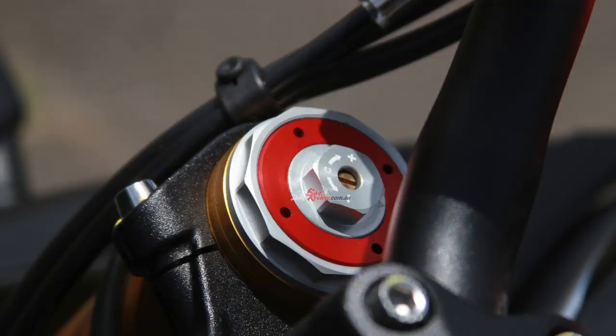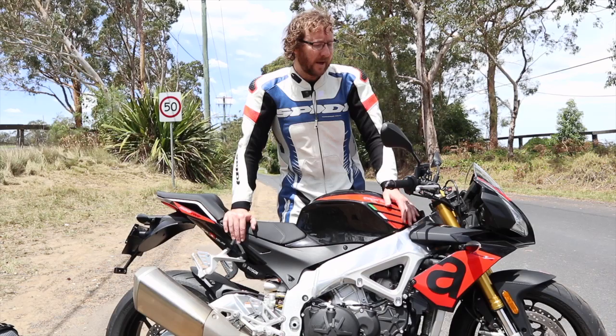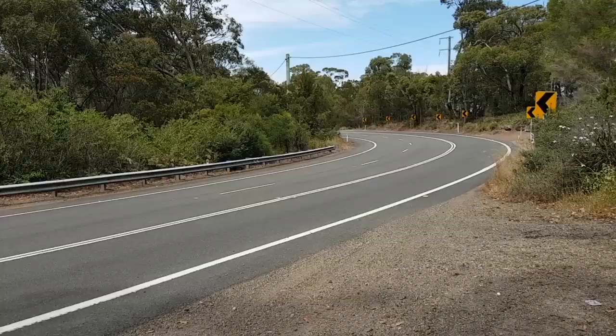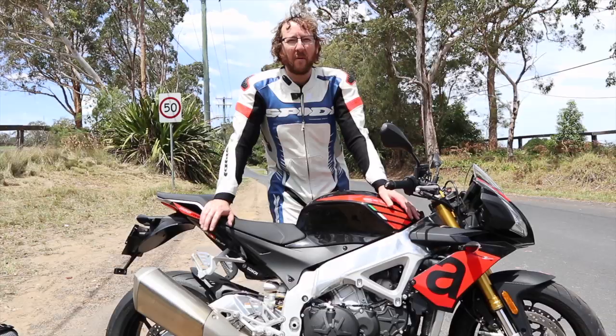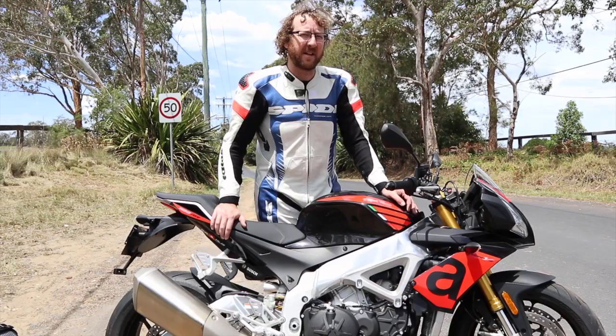It's got the SAC suspension and it's been fantastic, though I've got a bit of work to do on the shock setup. It's lacking in rebound damping at the moment and bucking around a bit, but I've still got the bike for another week. The geometry and bones are there — even without the suspension dialed in I'm having a reasonably good time cornering it.